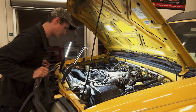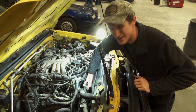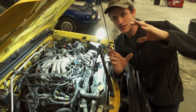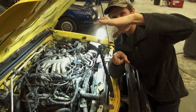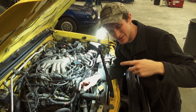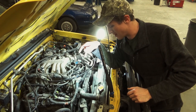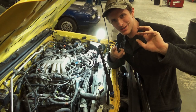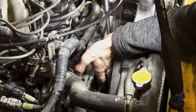Step one on this process is to loosen up the center bolt that's holding the idler — the bolt that's holding one end of the accessory. How it works is it moves the alternator or what have you: one bolt is stationary and then there's an assembly that moves the other half of that component. If you just start twirling the jack screw, a couple of kids I knew already spent like a hundred-some bucks for a new tensioner assembly because it just turns into a great big pretzel.